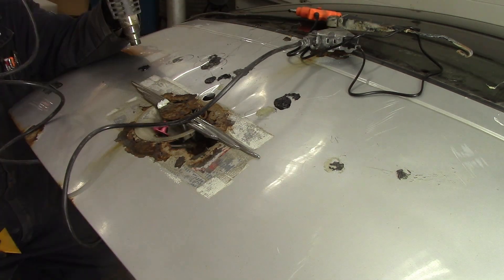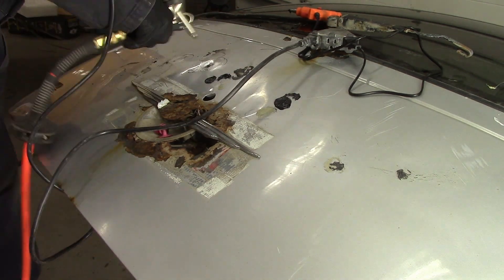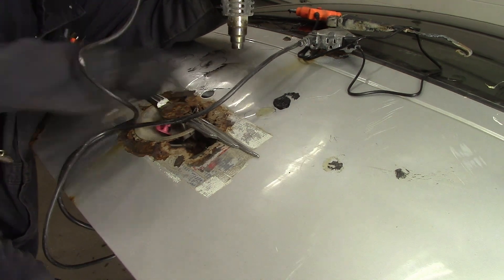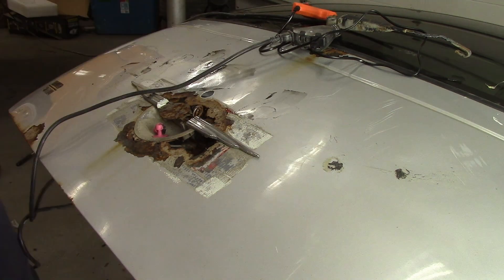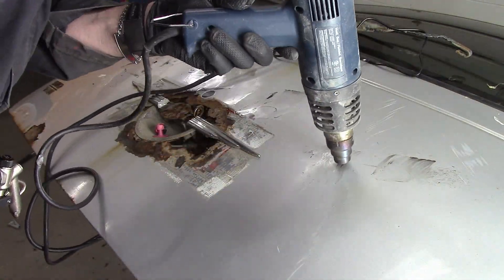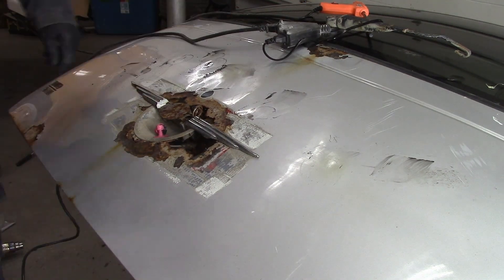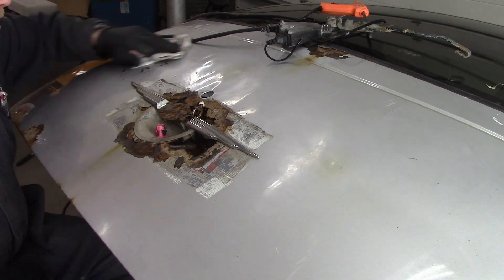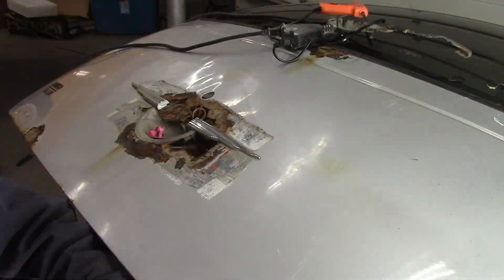I had this tailgate sitting in my backyard, but I sold my square body pickup so I don't have any way of getting rid of it — other than cutting it up and making it disappear in the weekly garbage collection week by week. I did resort to my favorite: the heat gun. Thanks to Jeff Thiessen of Trendsetter Automotive, who showed me a way of pulling dents out when you can't get to the other side. Other than burning the paint a bit, I did get it a little better and was happier with it. Check the video above on pulling the crushed roof out of my square body pickup when a crane fell on it — a disappointing day, that one.